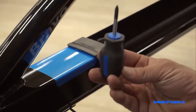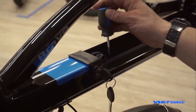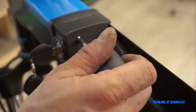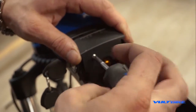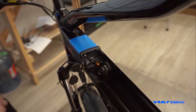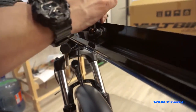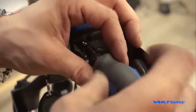This is done with three number one Phillips screws. Again, it's very important that you've drained residual energy from the harness because touching those two diodes without doing so will cause a spark. Start with the front Phillips bolt just above the lock pin — this removes the cover for the locking compartment. Keep your workspace organized and keep hardware together so you know what went where, as bolts are specific to their location.